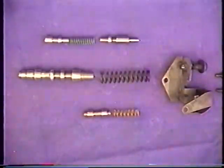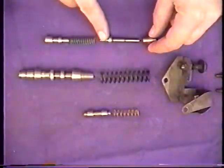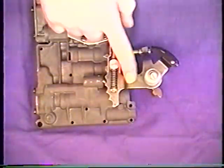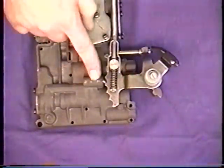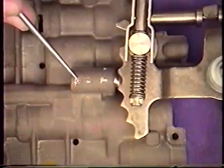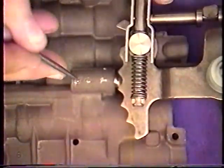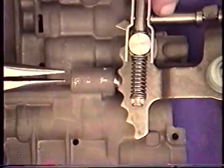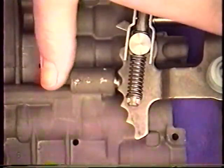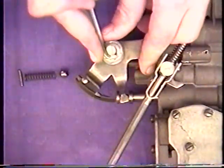Let's start a good habit: as these pieces come out of the valve body, lay them out on a clean shop towel in the same order you're taking them out — it goes the same with the valves. This is crucial to putting this back together the right way. Here's a look at the valve lineup from under the retainer; notice this one here has a sleeve that slides out — the largest holes in the back side of that sleeve. Next, we'll want to remove the rooster comb — this will take a little work. The detent ball and spring is held in by a pin, and at the factory they peen over a little aluminum to hold that pin in. Use a scribe to remove any aluminum around the top of that pin, and then using needle nose pliers, push the pin right out through the top. Put your thumb over the hole to catch the spring.